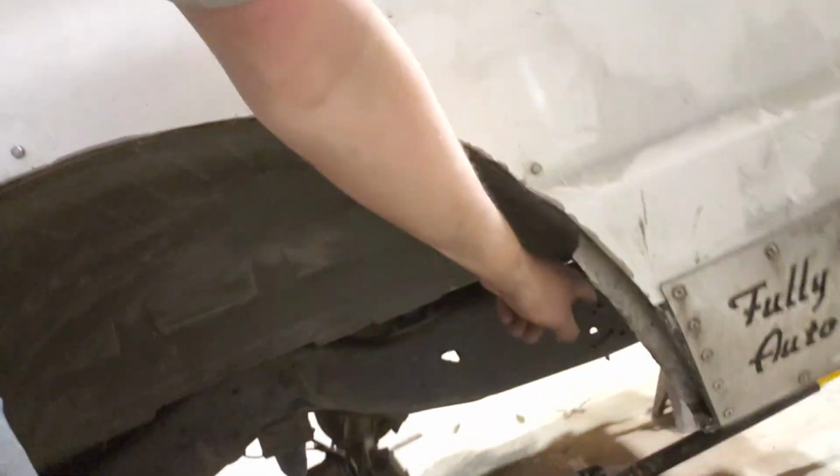just because there's so much going on, trying to get wheels and tires centered and perfect, and then getting the trailing arms up where they need to be without moving anything. Just constantly had to readjust everything like 6 times. Still didn't get it exactly where I wanted. I wanted it to be spaced 2 inches from the seam weld on each side, and it ended up being 2 5/8. Because one side was at 2 5/8 and one side was at 1.5 inches after we got everything up. So I was like, yeah, whatever.